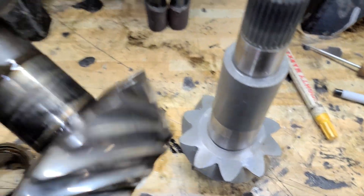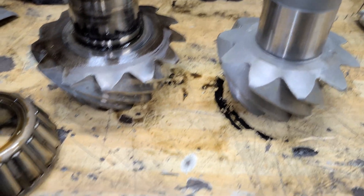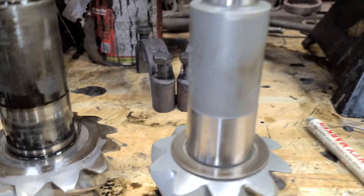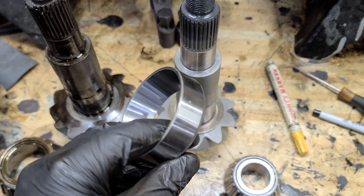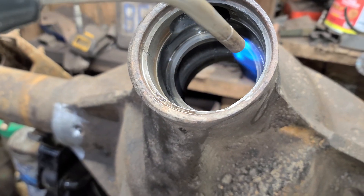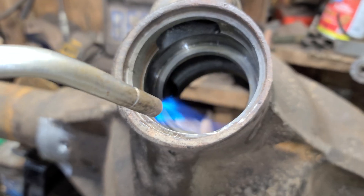Here's the old pinion and the new pinion. The old pinion is set for minus one and the new pinion is a zero. I took this bearing off because there's a shim underneath — these don't come with the master rebuild kit — so I'll throw that shim on top and press the new bearing on. For the front bearing race, I'm going to put it in the freezer to cool it down and heat up the housing, so when I pull the bearing out of the freezer it should just slide straight in with less trouble.